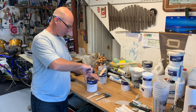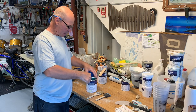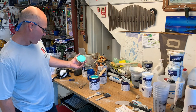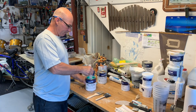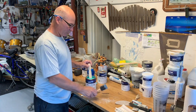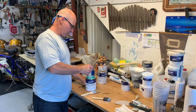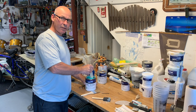The hull's all prepped and ready for the side paint. This is a Wet Edge seafoam. I usually like to use a real brush, but I found out that these foam brushes cut in a little better — they don't leave brush strokes. So first I'm going to do some cutting in, then I'm going to roll out.